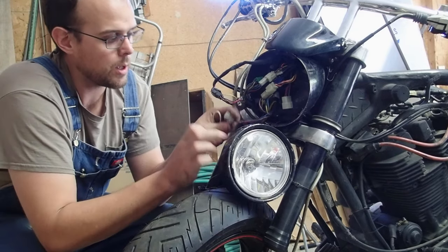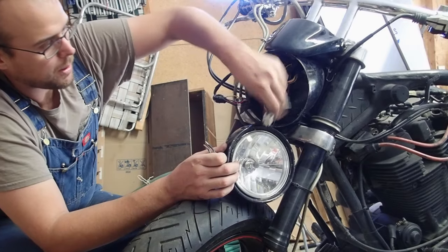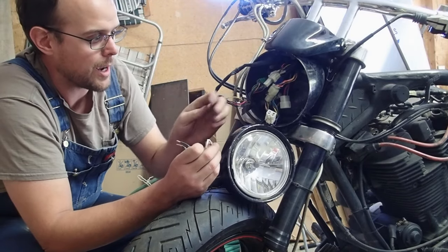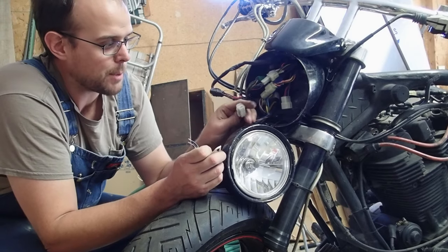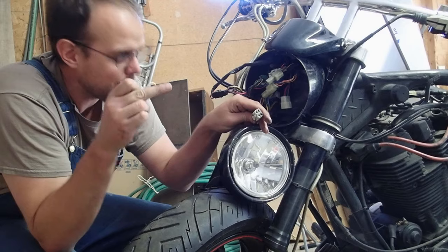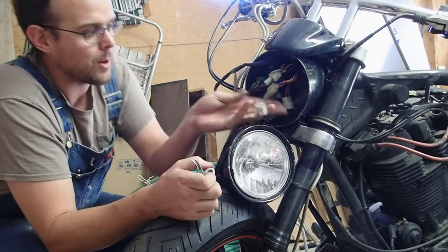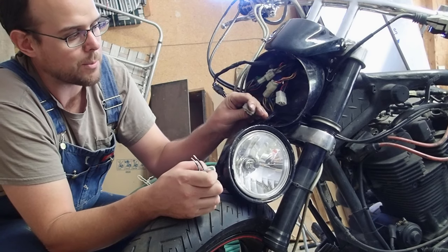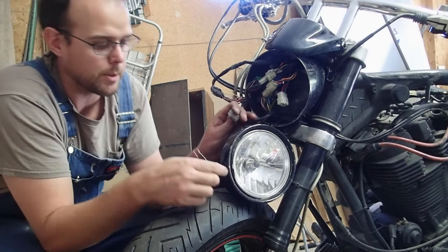The first jumper — this is your plug that normally goes to your ignition switch up here where your key is. It's in your headlight housing. I unplugged the plug and you want the female end. The female end is the end that goes back to the computer. You don't want the male end — the male end, when you look at the end of it, you're seeing all the prongs. You want the female end — when you look at the end of it, you see the receptors.